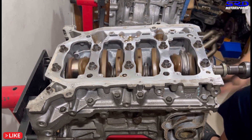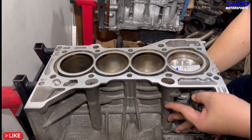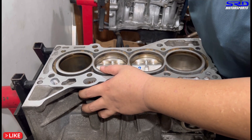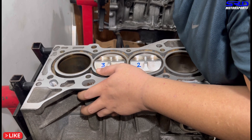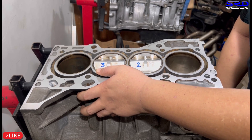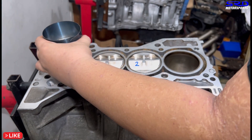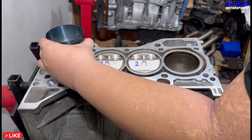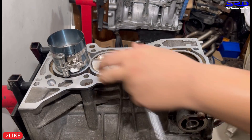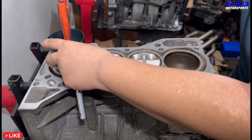It turns really good now. Flip it up for the last piston. Let me check the rod journal — I'd rather look at it with my own eyes. You could rely on having cylinders two and three at top dead center, but I prefer to visually confirm. Here's the last one — tap it in securely, perpendicular. Yes — that's it.